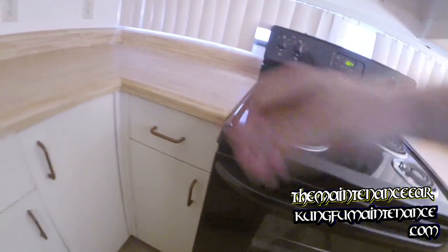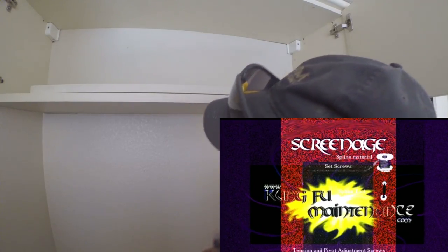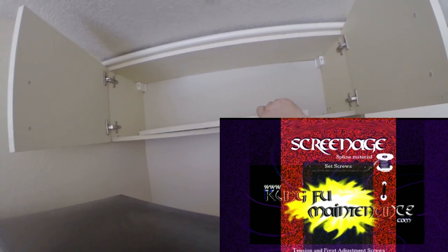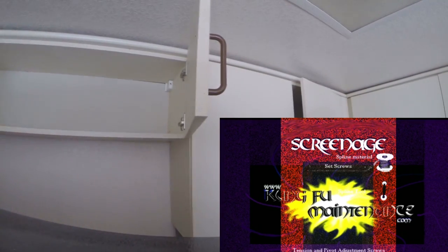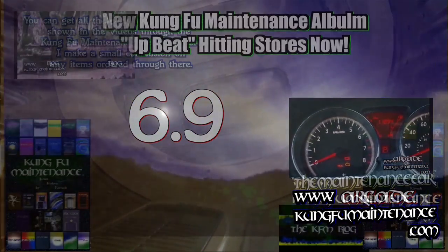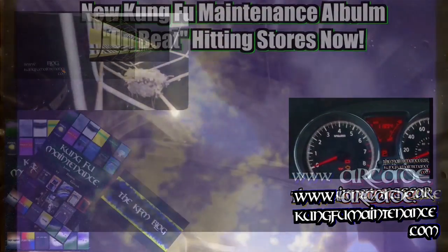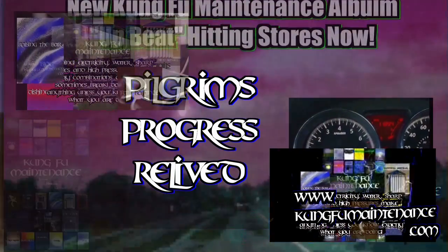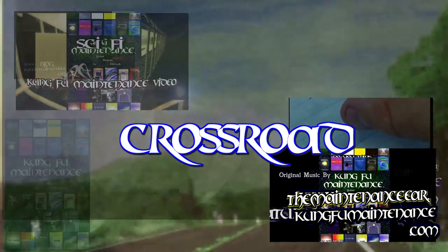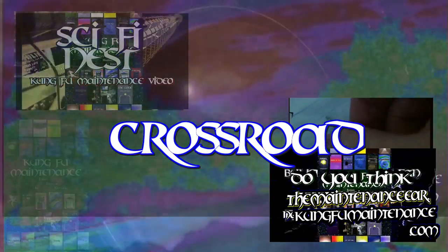Just need some cleaning to be all set. This one is better but I still got a little fine tuning to do. But once you get it exactly how you want it, what you can do is either run a bead of wood glue along the back inner corner at the bottom — the back corner inside the cabinet at the bottom — or a bead of silicone or caulking, anything that you can glue it in. It's going to hold it and keep it from slipping down. And if it's along that back corner it's just not going to be visible from the outside, so it's a nice easy way to make it last.